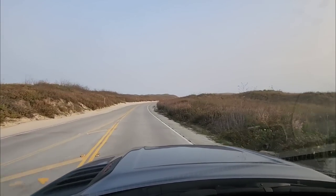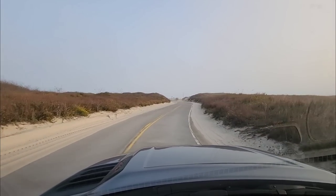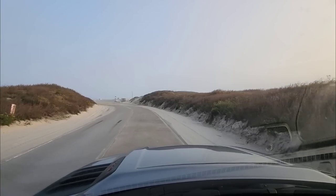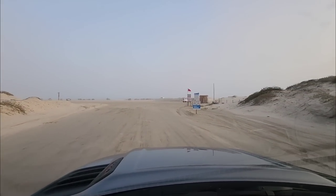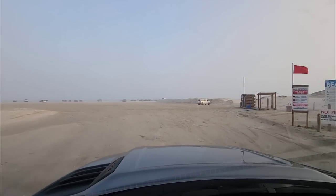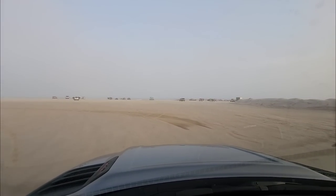And because of the curb weight of this truck being as heavy as it is, with that heavy duty frame, you're going to have the weight you need to be able to keep a trailer relatively steady. Now, you would probably still want to be concerned about sway, so having a sway controlling hitch probably isn't a bad thing. And then the other part you're probably going to want to be concerned about is specifically how the tires are going to handle different types of towing environments. And you can kind of feel that suspension or hear it in my voice as we go over bumps when I talk about that kind of bucking feel that you get with the suspension, more of a springy feel.